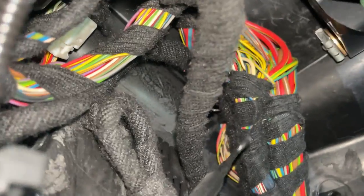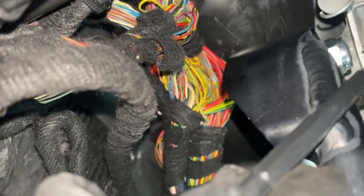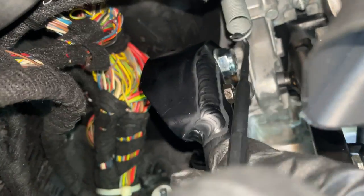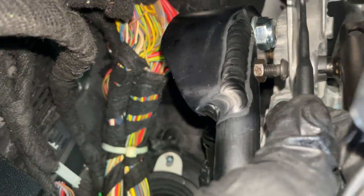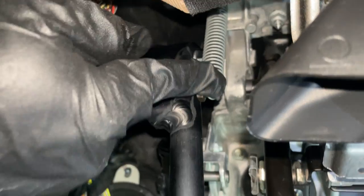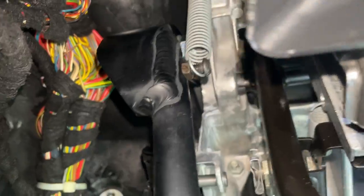I put the nut here and the bolt in from the other side. The bolt uses a 6mm Allen hex key and this side uses a 17mm socket or wrench. Now I'll be putting the lightweight spring from here into the screw that is over here. Again guys, be careful when playing with springs — you don't really know if they will fly or not.